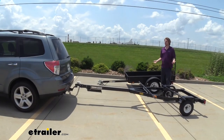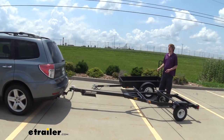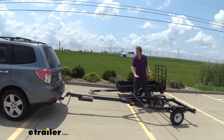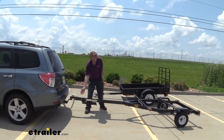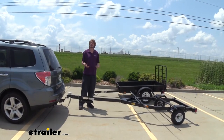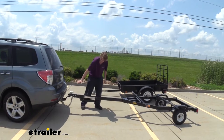Vehicles like the Subaru we've got here sit pretty low to the ground and they're best paired with lighter trailers such as the ones we're showing off. The 1 7/8 trailers are often pulled by these smaller vehicles, and with the hitch so low to the ground, in order to get a level trailer you'll often need a rise for these smaller hitches. We can see that when we're hooked up we do have a slight decline toward the back — we're slightly higher in the front — but our trailer is completely unloaded, so that's what we're looking for. When you load the trailer down it levels out completely.